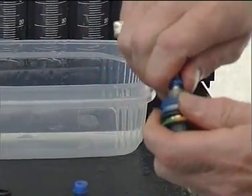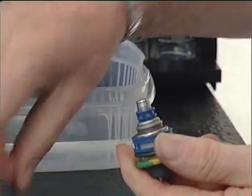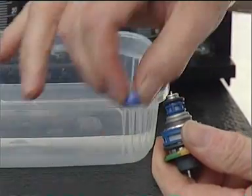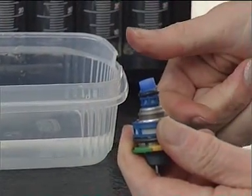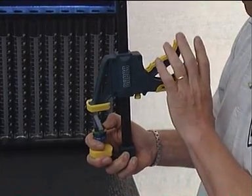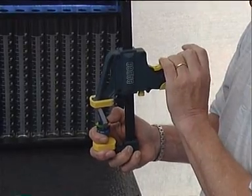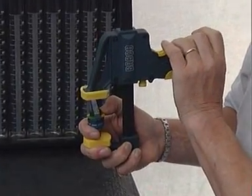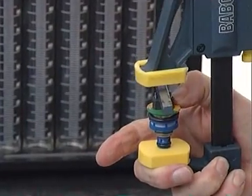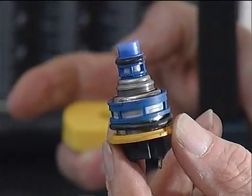Fit the new bottom spacer filter and bottom O-ring. Place the new pintle cap on the injector. At this time, the pintle cap will not fit correctly on the injector. Using the 8mm square bar and the injector cap replacement tool, locate the injector pintle cap end into the tool and place the 8mm bar between the electrical terminals. Squeeze the handle of the tool, ensuring that the bar stops the tool from damaging the electrical terminals. The Bosch SPI injector is now ready for retesting.